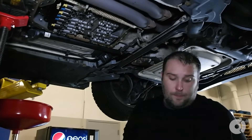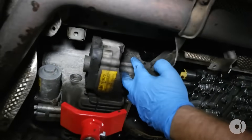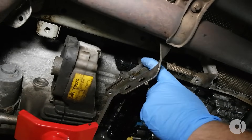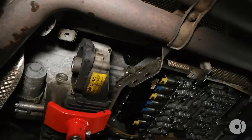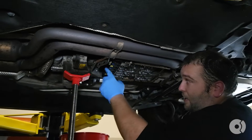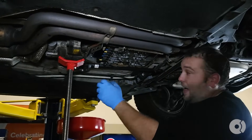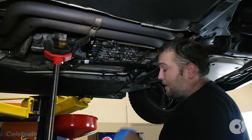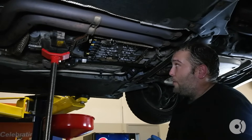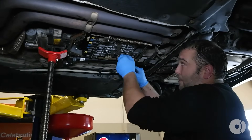We sell the solenoid kit from ZF for that. One other thing to note: way up in there is something called a sealing sleeve, and that's where the electrical connector comes into the transmission — those are really prone to leak. You do see a little bit of sweating there, but no stream of fluid coming down, so there's really no reason to address it this time. In order to replace that sealing sleeve, you would have to remove the pan and the mechatronic unit. Right here, this little clip — you'd pull that down and that would release that sealing sleeve from up top, just as a reference. I'm just going to go over some of these bolts and make sure they're still tight, checking that they haven't loosened up over time — like I said, it does happen.